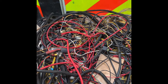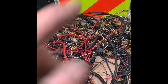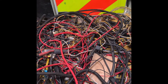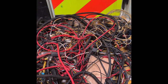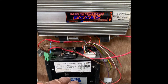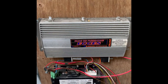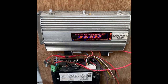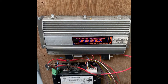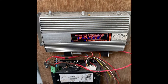That took a whole day to remove the wiring while keeping the van running, because it's all intermingled with the van's electrical system. When I took out the wiring loom for the sirens, I lost all my rear lights, brake lights, and indicators on the back of the van. I had to find the original wires, disconnect the genesis wires from them, and rewire them back up. A bit of a pain, but I have my lights working again.